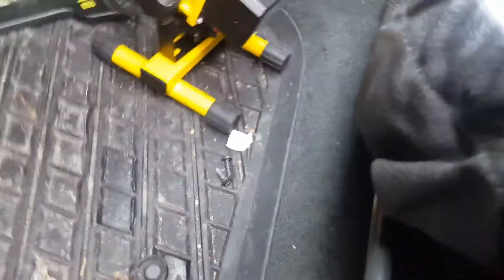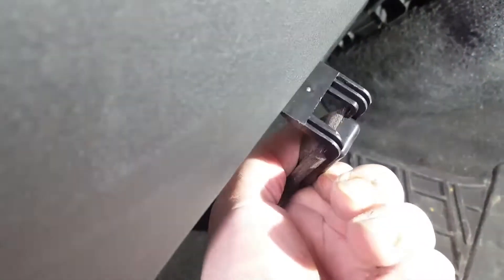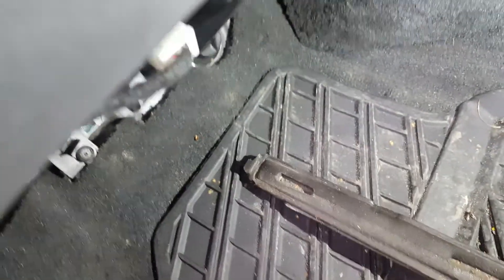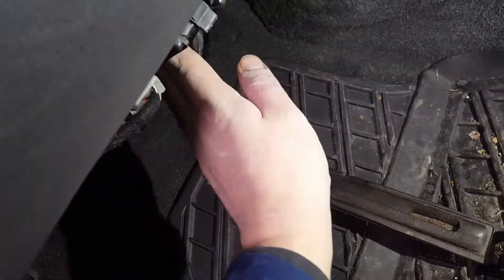To remove it, you take this kick panel out. This panel sits in here like this and it's secured — you can see the two screw holes at the front. They're just two normal Phillips screws down here, so just unscrew those two fronts and it comes out. Then undo this bit, which just pushes and unhooks — down it comes. Now pull out the old filter.